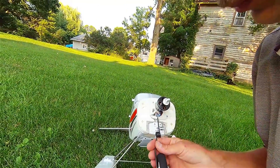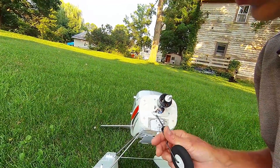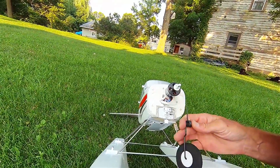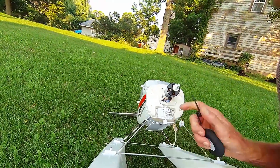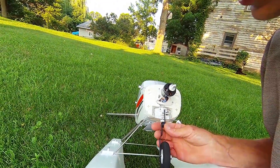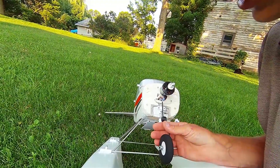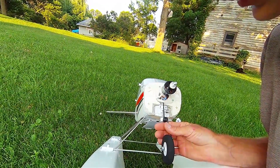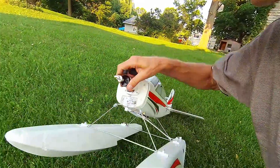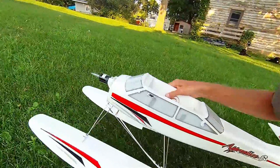Remove that and put the landing gear back in. The reason I do that is because without it you really don't know where straight is, and if you're going to convert this back and forth, it would be nice to have this gear linkage set up so when you switch back to land base, the nose gear is actually lined up for you. So put the landing gear back in and first focus on the original linkage applied for the nose gear.